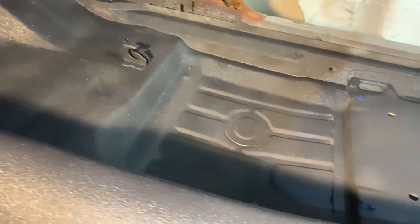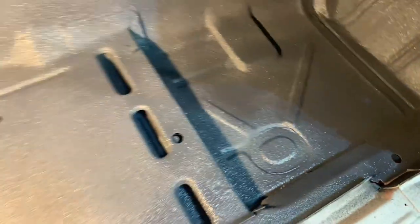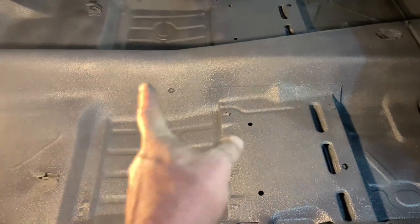All right, looks all finished and done. This is just the sound barrier coat so far. It kind of looks just like bed liner more or less, and it works on kind of the same premise. Got everything coated all the way up to the firewall — did the whole seams, floor, everything. Now basically got to wait 24 hours to put the ceramic coat on top of this.